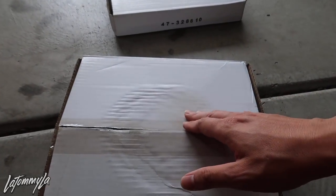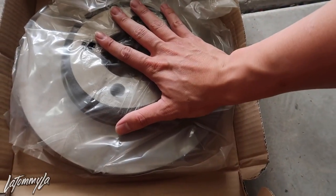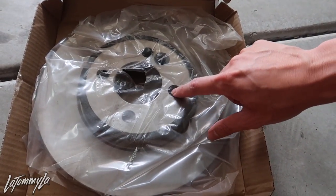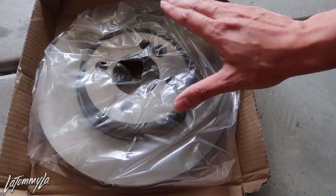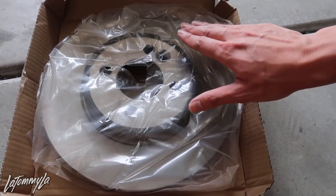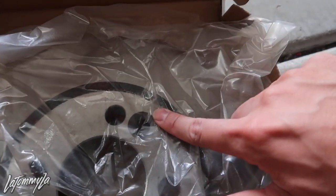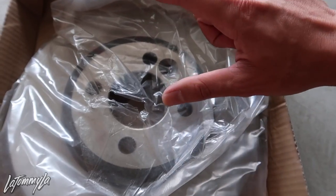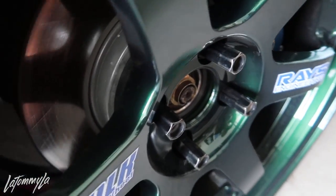This is the same setup on my hatch. This is a Mini Cooper 2007 to 2011, Mini Cooper Type S or base model, turbo, whatever. Any of those Mini Coopers that come with a stock 280mm or 282mm front rotor - which this is off of. This hole right here, which is normally held on by a screw, will not work on the Civic, just to let you guys know that. But I've been running it fine without it.